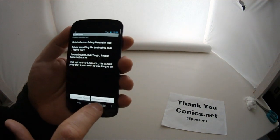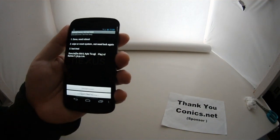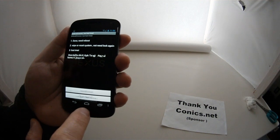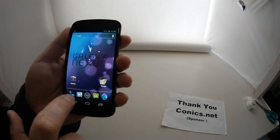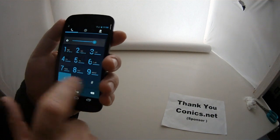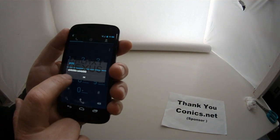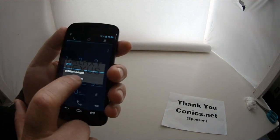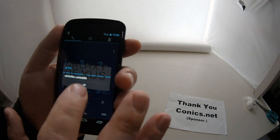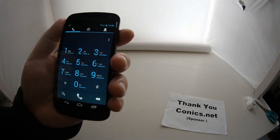Now we're going to go to Unlock Forever and click that. Instead of unlock, we're going to hit Lock Again, and that's going to restore the original IMEI. The reason is that when you use this app and then flash the phone, the IMEI becomes a generic one — not the original. You can verify by dialing *#06# and it'll show a generic IMEI starting with 004999010046 and ending in 40000, which can be a problem for some people using different carriers.